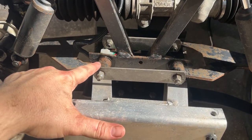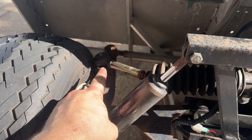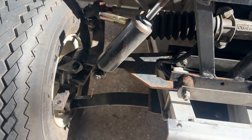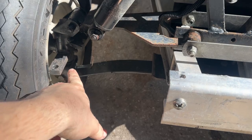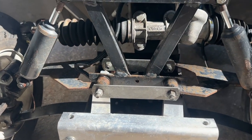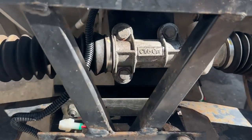But if you want to keep it stock, take a look at these bushings — get those replaced. Do your ball joints and your control arm, get those replaced as well, and take a look at your bushings in your hubs. That's going to be a lot of the problem on these Club Cars, as these things are old.